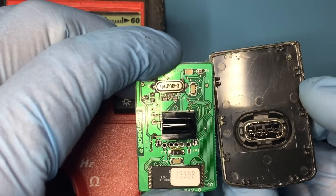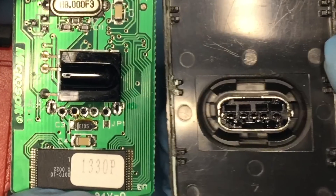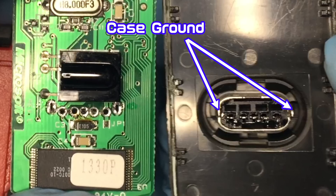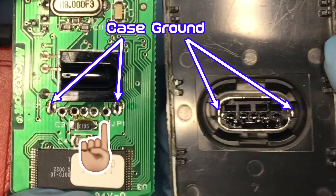Now to identify what the pins are on the male Xbox plug. The easiest and surest way is to find out which pin is the ground pin. A closer look reveals the outer slotted pins on the plug's metal sleeve that connect to chassis ground. With that known, obviously the slotted through holes on the board are ground. Now we can do a continuity test to find out which of these five regular through holes is ground.